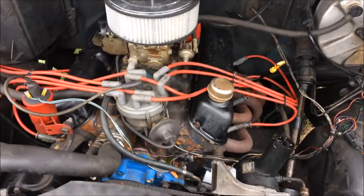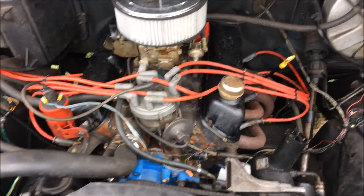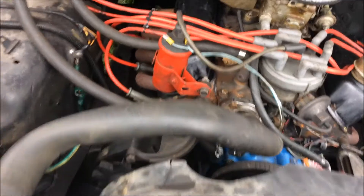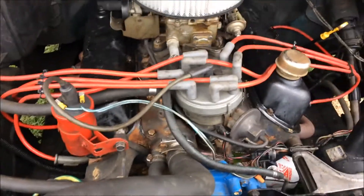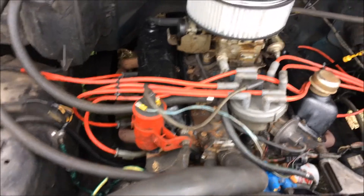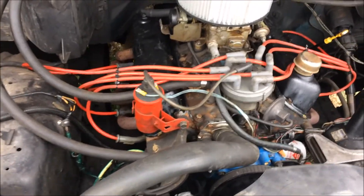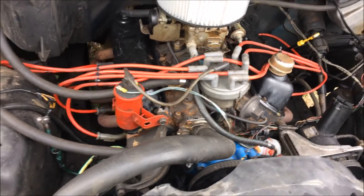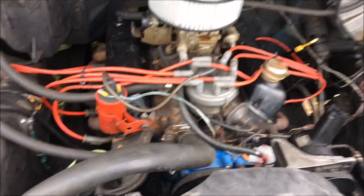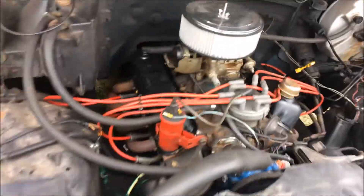This truck was actually partially taken apart. They had some really good performance parts they were going to put on it. They had broke off the stock heads — had a rocker bolt that broke off. I bought it and put all the performance parts back up in my stash. There was a new cam, lifters, hardened pushrods, 750 Holley, Edelbrock Performer RPM intake ported to match the heads. The heads are with it — they've been ported on the intake and exhaust. It's 194s and 1.6 valves. Some decent stuff.